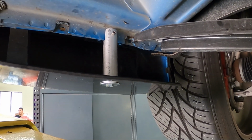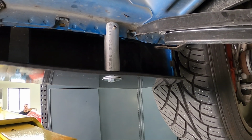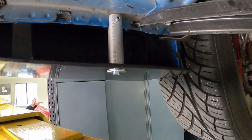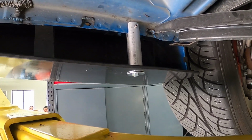Being that this is a Durango SRT here, having race ramps or jacks is going to be required. You need to get the vehicle high enough off the ground so you can get underneath the edge and view the pinch welds and have full access to install the side mounting hardware.